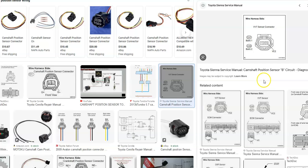That voltage is usually 12 volts but can be five or eight volts — you'll need schematics for your particular Toyota to know for sure. As long as you're getting voltage to one of those outer pins when the key's in the on position, that's what you want. The other wire is the signal wire going back to the onboard computer. Many mechanics will attach a known-good sensor to the harness, go from the ground wire to the signal wire back to the computer, put a piece of metal in front of the sensor, and it'll toggle from five volts to zero volts to confirm the whole circuit is working.